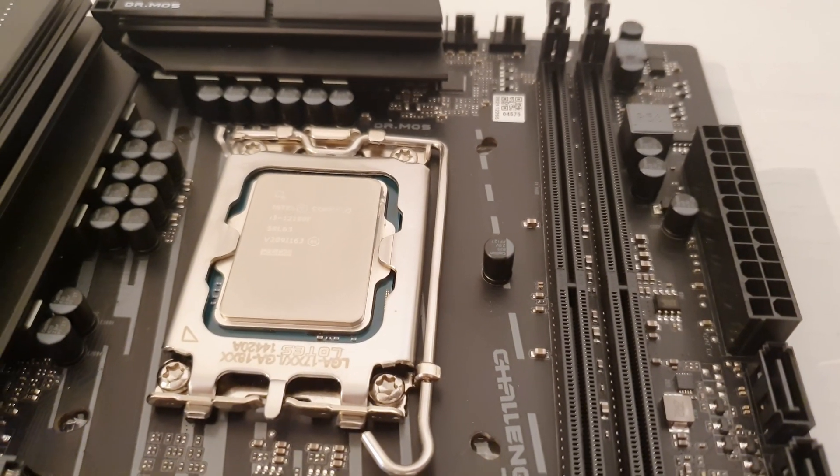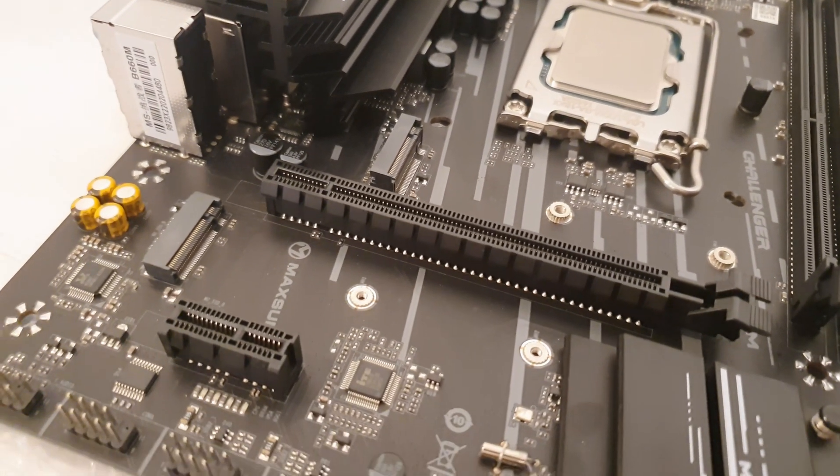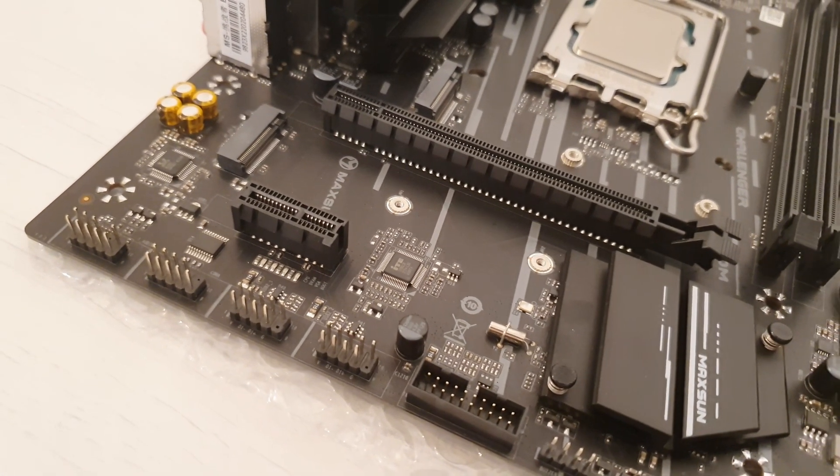The motherboard looks like this, and what's important about it is that even though it is an LGA1700 platform, the Chinese manufacturer still added extra holes so you can install standard LGA1151 or LGA1200 CPU coolers. For example, I can install a simple Intel box cooler from the previous generation and it just works. I bought a cheap i3 CPU without a box cooler, so this was very valuable for me. If you're hunting for cheap i3 or i5 CPUs from AliExpress, in most cases they come without a box cooler, while at the local market you can find these old Intel box coolers for almost nothing.